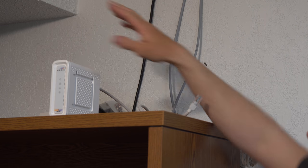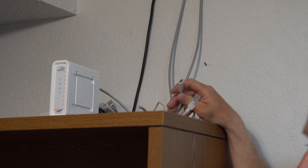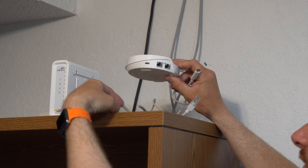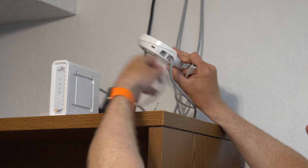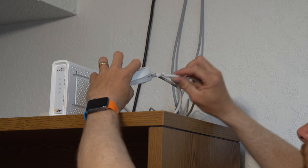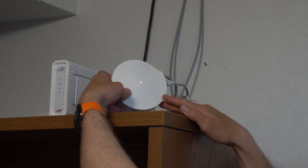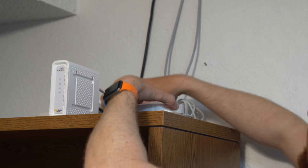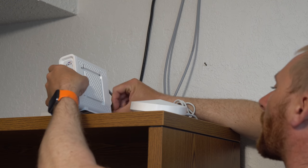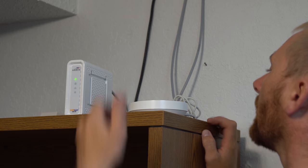My modem is up here — if you've watched my other videos this may look familiar. I have the Deco unit with the power cord plugged in to my surge protector. These ports are universal so it'll figure out what's coming in and going out. I have a switch going to my computer and the modem plugged in as well. My white cable goes to my modem. I'm plugging that in and you'll see the yellow light as it starts up. I'm also going to go ahead and power up my modem.